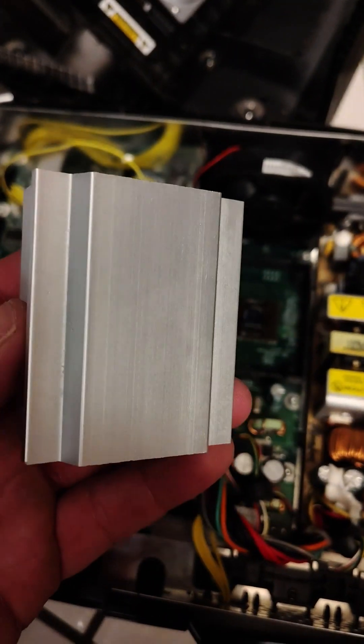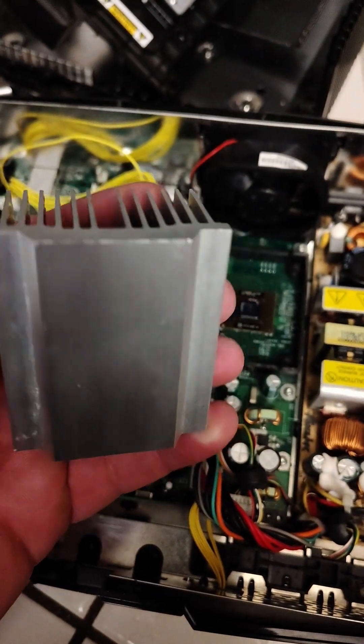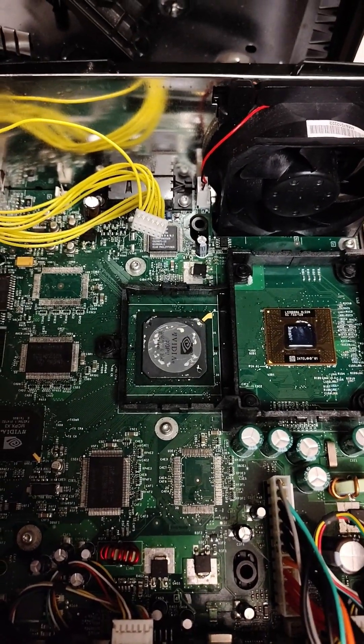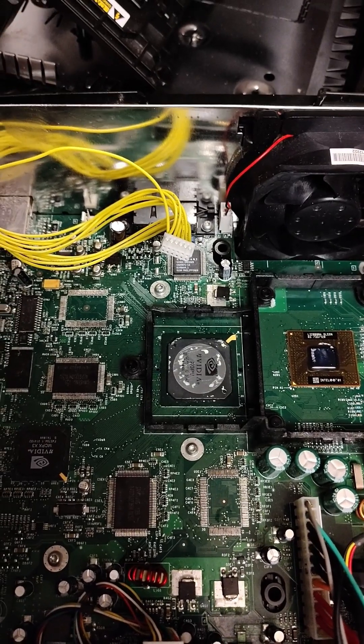Watch your — see how clean that is? That's like a little duster. Clean this with the isopropyl. Blow this off. Same thing — clean with isopropyl, blow it off. I have a little bit of thermal paste left on that and I'm going to finish scraping it off.